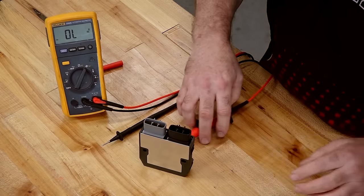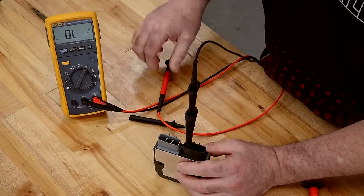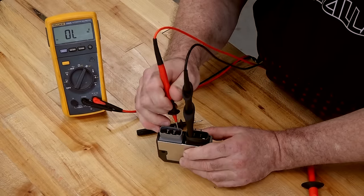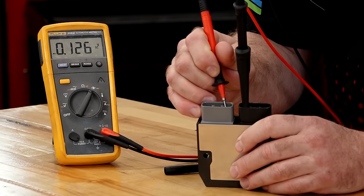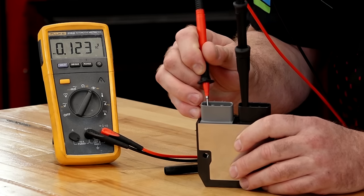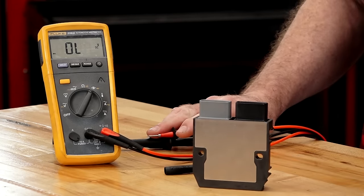Now we take our negative lead off the voltmeter, put it to the positive side of the regulator rectifier terminal, and then we'll go to our three points, which would forward bias each one of these diodes. Now how did that change? Should be some diodes there, right? Well, actually, they are there.